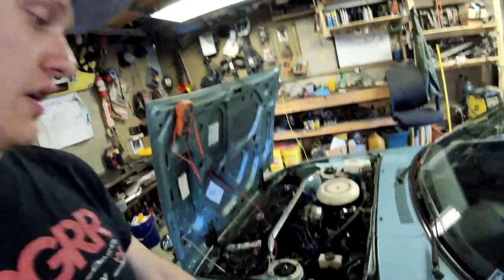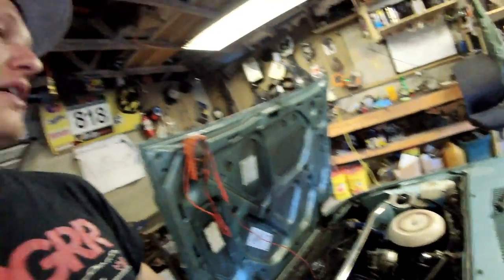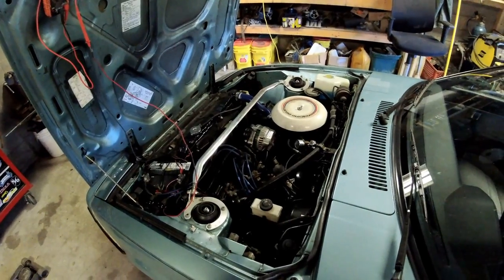On a 78–80 RX-7, the gauge sensor wires come from the body harness on the opposite side. On a GS or LSE, wires come from both sides, so you need to be aware when unplugging the emissions harness — note where wires come from and make sure you don't need them. If you're okay using the Holley EFI screen to monitor coolant temp and have an aftermarket oil pressure gauge, you can skip keeping the dash gauges functional, but I intend to keep all of them working on this car.